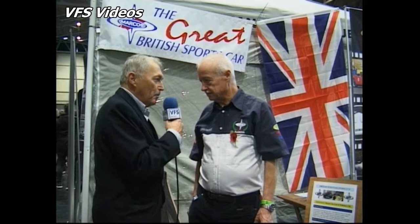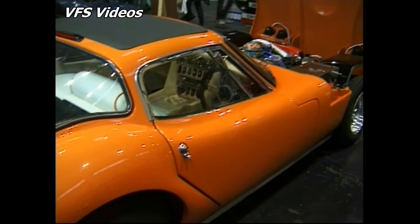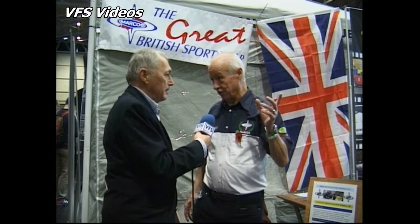What about the one in the middle, the orange one? The orange one is the earlier version. It's a metal chassis and that's with the V6 — slightly less in performance. You'll notice it's slightly narrower, because over the years the cars have got wider. That particular vehicle will have a Triumph, probably Vitesse, front-end steering mechanism. As the years progressed it changed to a Ford Granada, which is wider. And then the next car further along is even wider still.